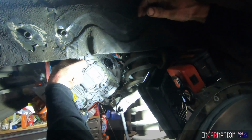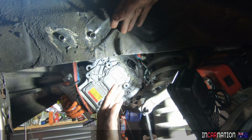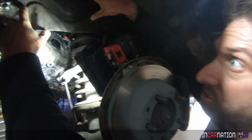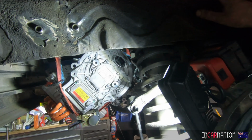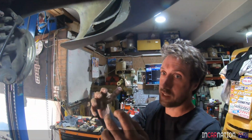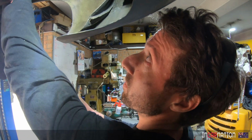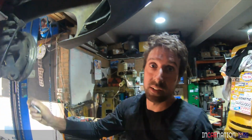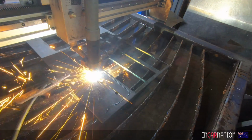As the weight of the mount's pulling down, the bolts don't want to twist up. If we just weld it to that interface, it's just going to want to peel it. So now it shares the load with this outer skin. We'll weld this to the tube, and this side will be welded to the tube. So we're actually, the structure's a lot stronger. So even though we've got a plate that's bolted here, this is bolted to the plate and it's welded to this side. So got it. It's nice and strong. It's nice and strong.